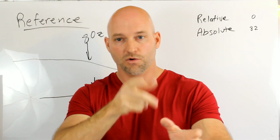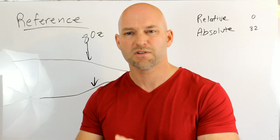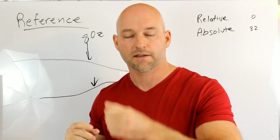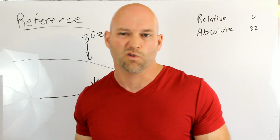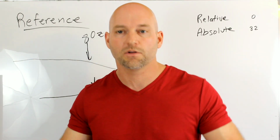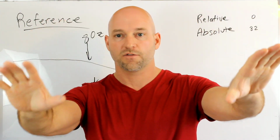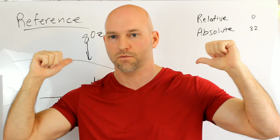If you have dropouts, go watch episode 1. It's going to fix those for you. But you're going to notice behind you, if all the speakers are the same exact level per the mic, it's going to sound quieter. So boost them until they sound normal, until it sounds even. That's what I do. Play with it a little, but I would not touch, especially, the front 3 or the surrounds. Don't touch those. If you're going to boost anything at all, boost the ones behind you.